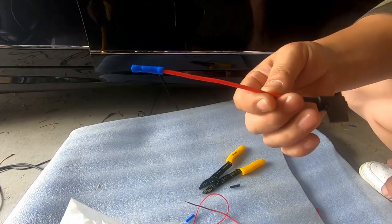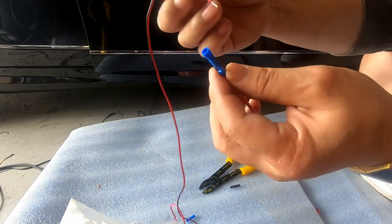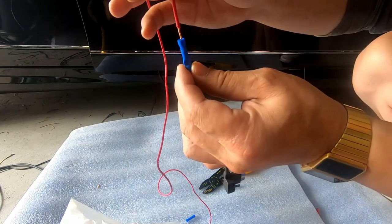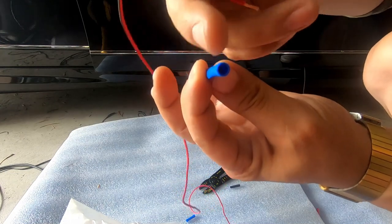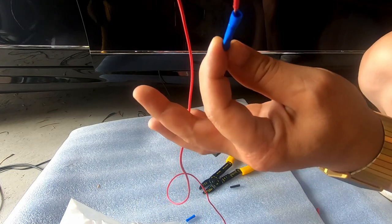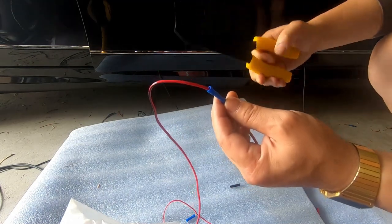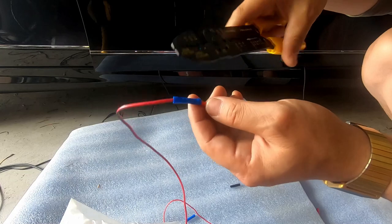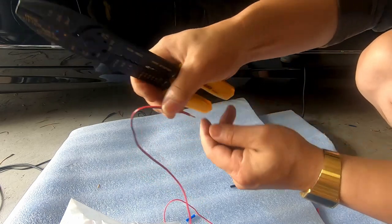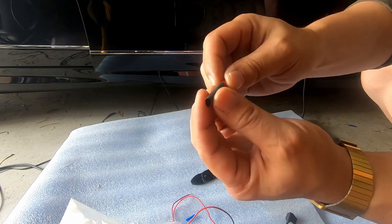Here's a quick video on how to use one of these connectors. Get the cable you're using to extend whatever you're connecting, or the cable you're plugging into your fuse tap, and put it inside — make sure you get inside the little hole in the actual contact area, so put it right in the centre. Then grab a pair of crimpers and crimp it down. Follow your colour code — so if you're using a blue one, follow the blue colour for insulated closures.